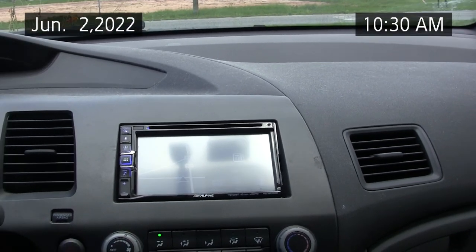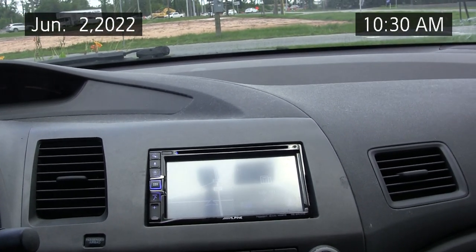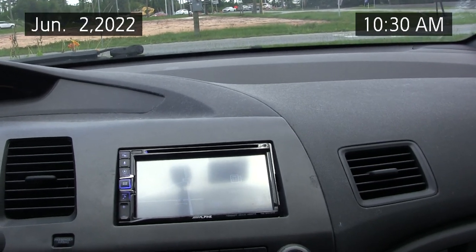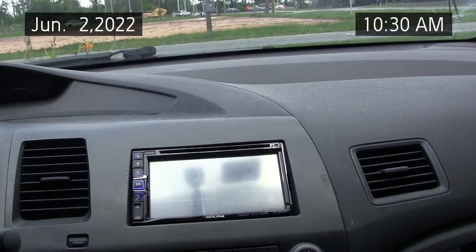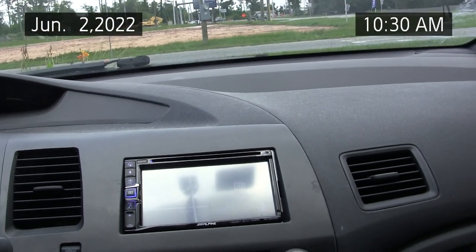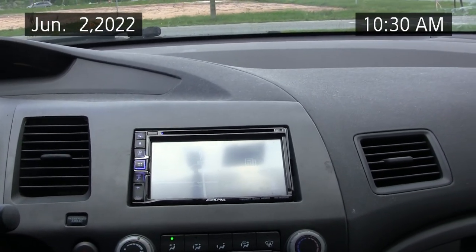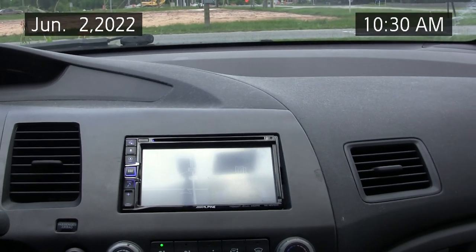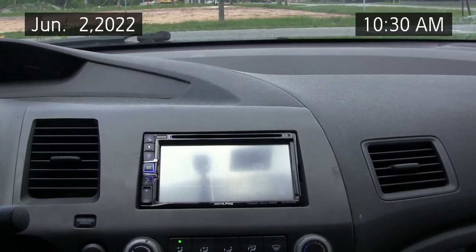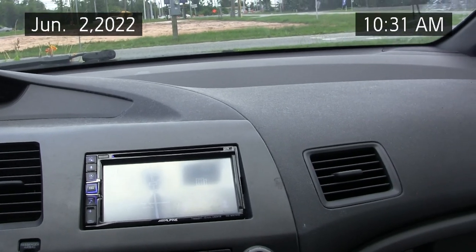Now, the problem with having too much refrigerant is you can damage the compressor. And the other problem is if you add that sealant leak stuff, you can gum up the system. If you have a system that has corrosion or is partially obstructed and you add leak stop, you can gum up the whole system. And if you add too much refrigerant, you can damage the compressor. And if you damage the compressor, you can put contaminants in the system, and in modern automobiles, you may not be able to flush components properly. You have to replace them. So there's a lot of reasons why you want to have a very experienced auto air conditioning technician